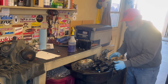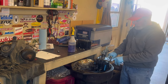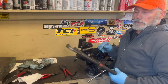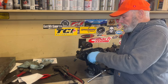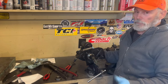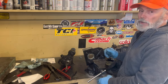Comparing the rod length, I think I will probably be okay. However, I need to swap out the plates, so we'll do that now. Just a side note, these big nuts are kind of a pain in the butt to remove. I kind of knock them loose and then they'll come right off, but make sure you torque those back real good, and don't forget the snap ring. That snap ring is a safety feature that'll keep that from coming off.